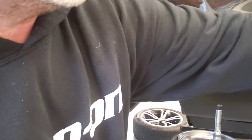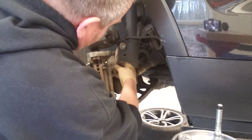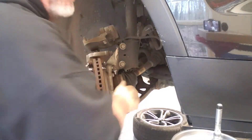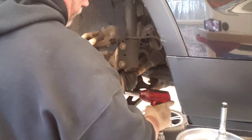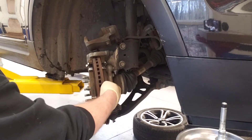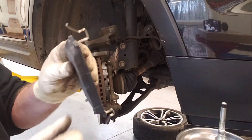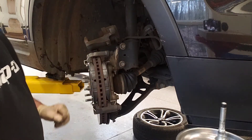Back at the car — the caliper bracket has been prepped. Double check it's greased up, slide it on top of the rotor, and put the two bolts back in. Some guys like to put thread lock on these — that's up to you. Tighten them up well. Next, we'll put the pads on. The pads are marked outer and inner: the inner goes on the inboard side and just slides on. They have a little tang for anti-rattle, anti-vibration, anti-squeal. The outer goes on the same way.